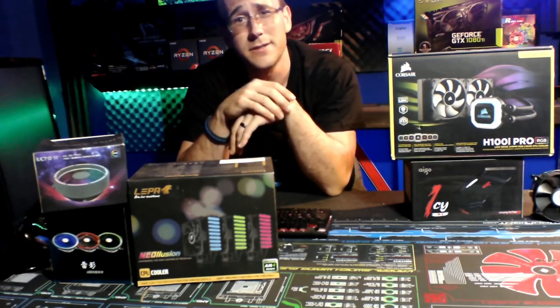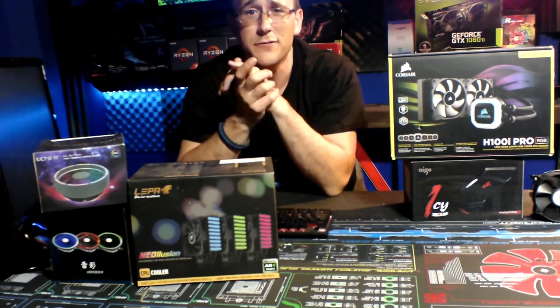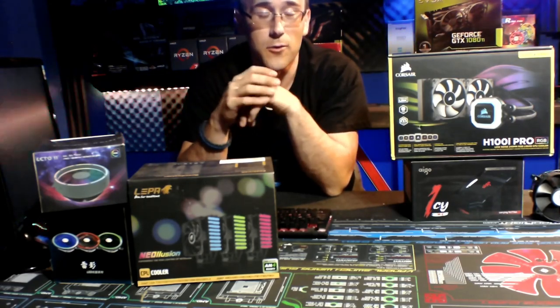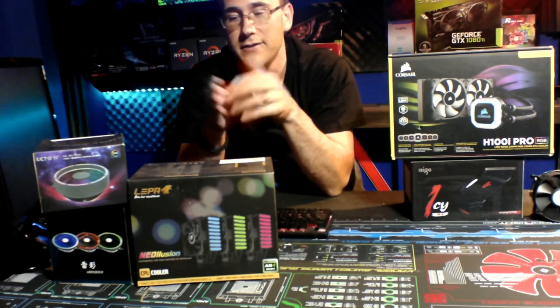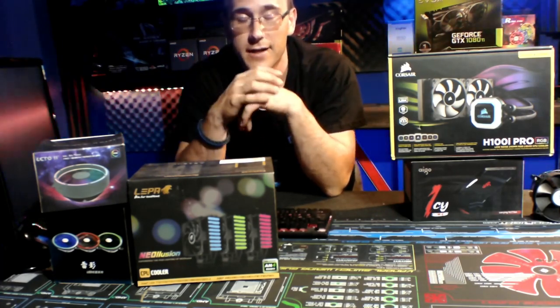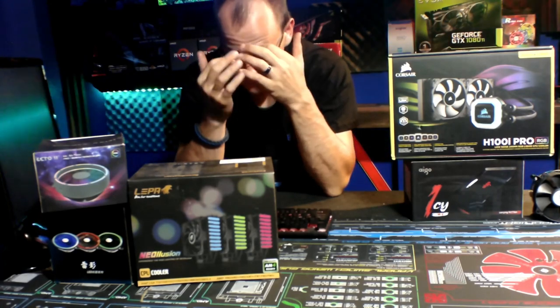With CPU coolers, you don't have that problem. The fan breaks, you replace the fan. That's it. And there are no bells or warning whistles that will go off with that. You'll just physically see it. With AIOs, you don't know that until your system cooks.